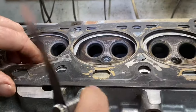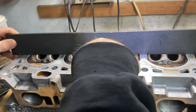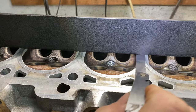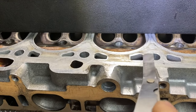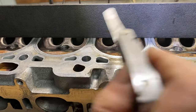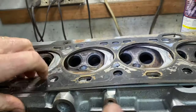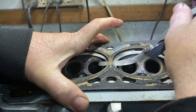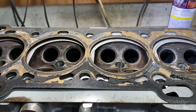Here's the head. When the gasket blows, the head warps. What I mean by warp — I'm using a mechanic's straight edge here — you're gonna have clearance underneath it. When a feeler gauge slips under like that, that means it's blown. That's what pumps up your radiator and makes coolant come out of the overflow. If the cooling passages are blown, it mixes with the oil and that's how you get that milkshake look. Now, if it's warped and you have clearance here, how is that sealer gonna seal up this area, the coolant passages, the oil passages, so it's 100% safe and reliable? It's not. It's a gimmick.